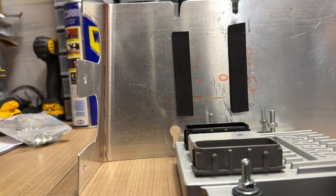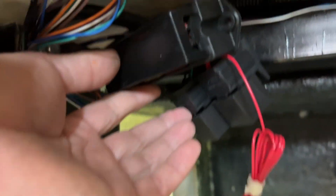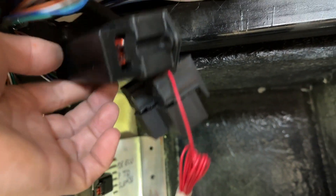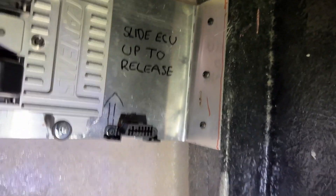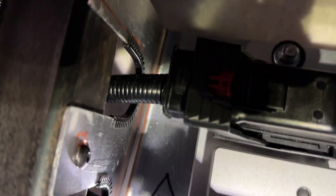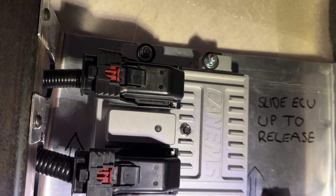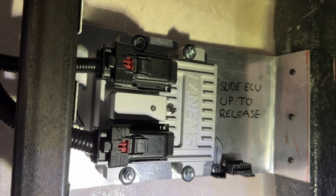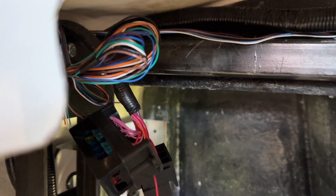I think I'm going to go ahead and mount this and we'll be able to slide it in, lock the clips in, and move on. The fuses and relays will go somewhere up on this top rail — not too sure how it's going to impact the relays from the AK loom. The bracket's looking pretty good — the OBD port is all nice and secure, cables coming through the strip grommets so no wearing can happen. The ECU is removable by disconnecting and sliding upwards. Something else to note: my accelerator cable isn't long enough to reach that connector, so that's a little extension job.